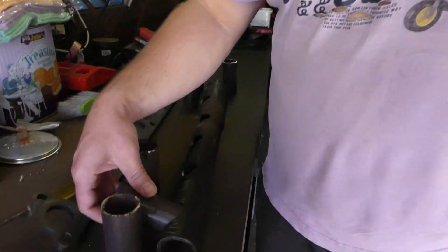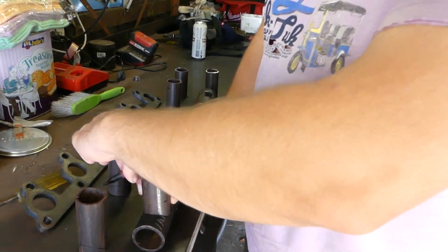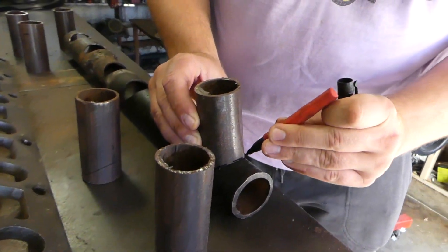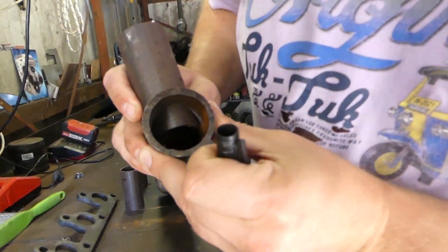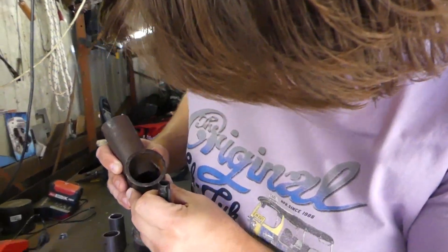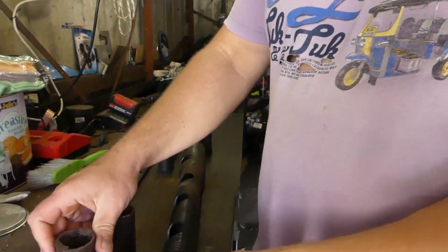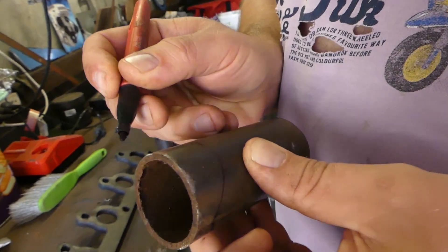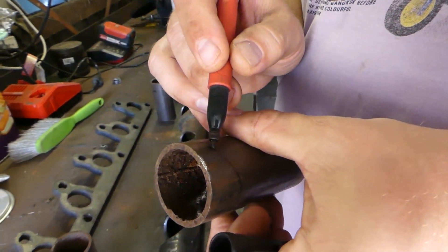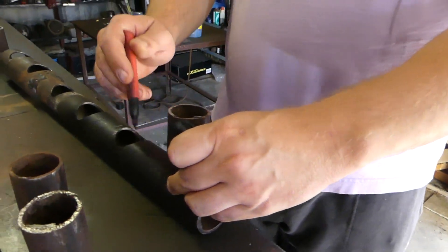I'm just putting it in and trying to mark them more consistently. This is just so the gases sort of flow, because if you have a look in there — if we don't do that — you can see when the thing sits in there it's blocking half the thing. You're not going to have a good time. You can't really do too much there, so this is just really for flow benefits. We'll just angle grind that, what you're marking out there — yeah, we'll just get rid of these bits. We're not going to go over the top with it, just mark them out and cut this extra material out — it'll work.